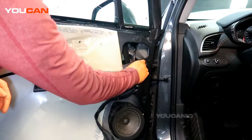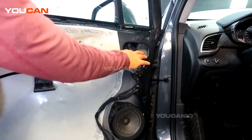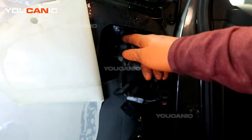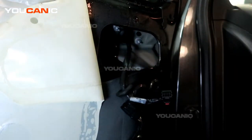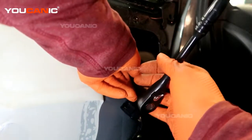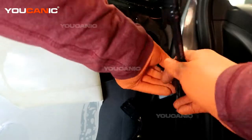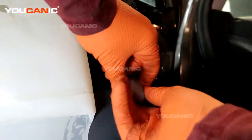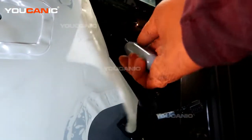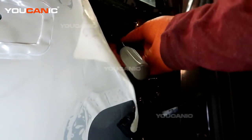Press this grommet through so that the electric is freed from the door panel. Then in here we have our three nuts — they are size 10 and you're going to need a 10mm deep socket. When you take the last nut out, you're going to want to put your hand around the outside to hold the mirror so it doesn't fall off.